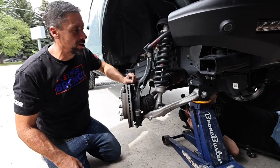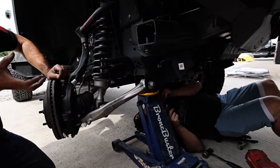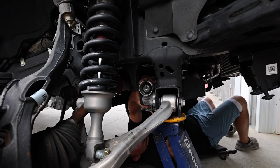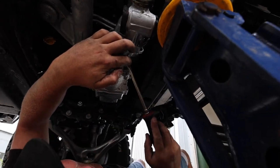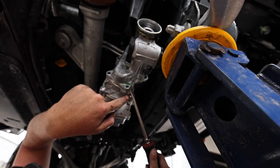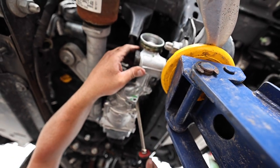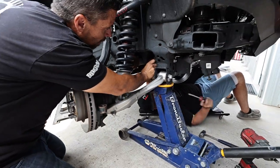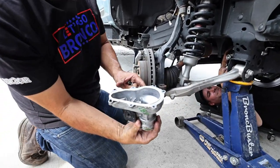Next step: you're going to want a screwdriver and hammer, find a spot to pry up in there to pry that housing off. Talon has a magical spot down at the bottom — basically put your flat blade screwdriver in that pocket and pry on that bolt head, and you can typically get it to pop off. So now with that off, this is what it looks like.